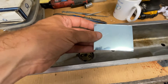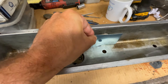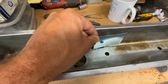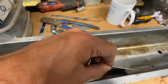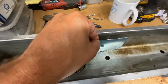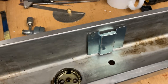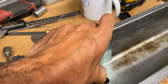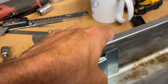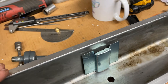My thinking here is I've cut an aluminium plate — this is 8 centimetres by 6 centimetres — and I'm thinking I can form that into a baffle that'll be one to two millimetres away from the edge, then maybe secure it with one screw straight through the casing underneath the existing 10 millimetre hole, to put the casing under pressure but not give an obvious route for the oil. I've got my little mock-up plate stuck on with some blue tack just to position it, and I'm going to put the cover back on the car just to make sure it doesn't foul with any of the springs.